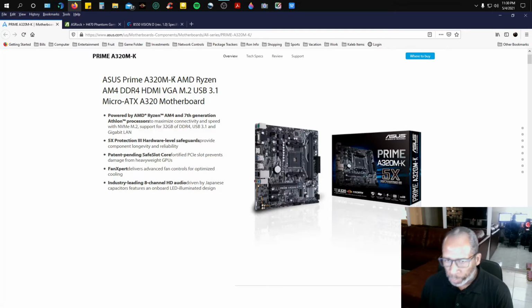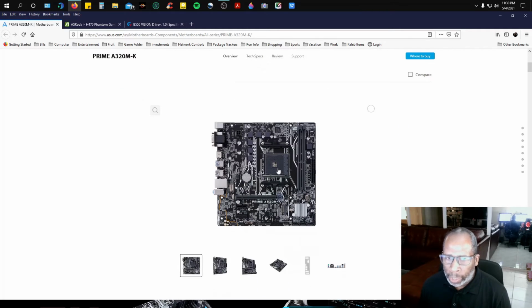So let's get back into that. That's a good thing to keep in your memory there. When you connect the M.2, especially on the lower motherboards that are non-overclockable and only for basic users, you lose that first SATA port when you connect the M.2. Now, let's get into why I say basic users like me pick boards like this.